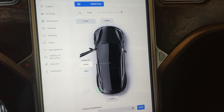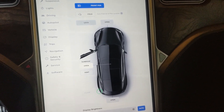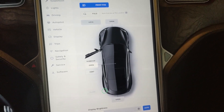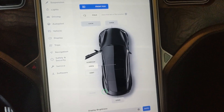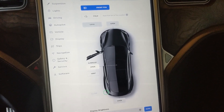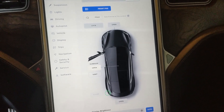Which I'll be showing you next. Basically, I will use a device called SonOff, which can be bought online for a few bucks. It has to have the Wi-Fi feature. It is basically a switching device, so when the device connects to the home Wi-Fi, it should turn the switch off automatically. And when it is not connected to home Wi-Fi, it should turn the switch on so the camera can start recording.